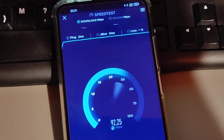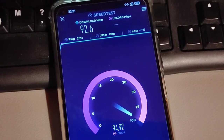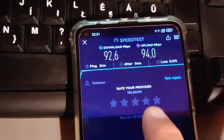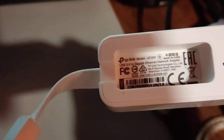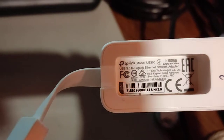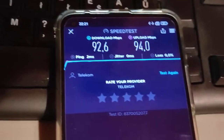The limitation here is that I have an old Ethernet cable, so it's just a 100 megabit cable, because my internet is 300 megabits bandwidth. So I should get another Ethernet cable — or maybe this adapter is not a gigabit compatible device and is only 100 megabit. Oh, this is actually a gigabit Ethernet adapter, so yeah, my Ethernet cable is not good here. But anyway, we're almost hitting 100 megabit and this is nice.